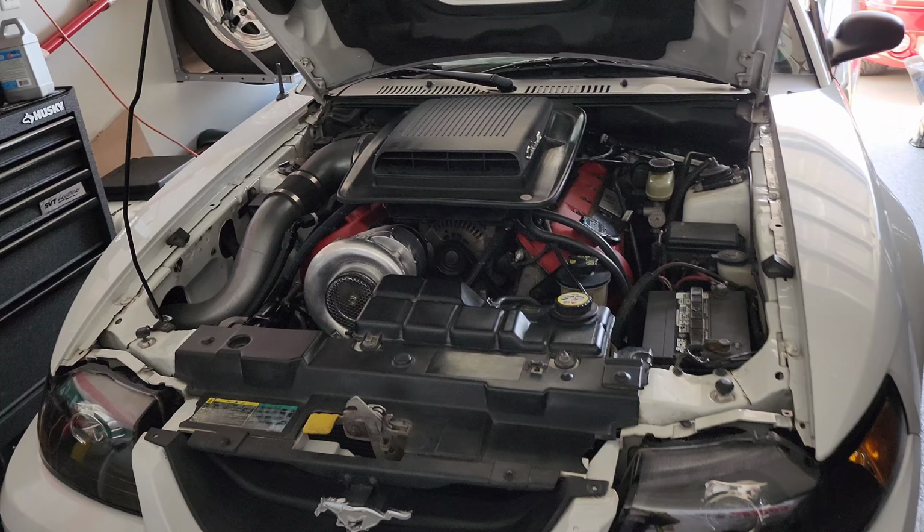With this supercharger, there's a nut on the bottom of it. This is the D1 SC. There's a nut at the bottom, and that's how you drain it. There's also a flathead screw on the top in the place of which I'm squeezing this fluid in. You take that off, and it has a dipstick with it as well. You just put the whole bottle, 6 ounces of ProCharger supercharger oil, or whatever brand supercharger fluid your supercharger recommends.